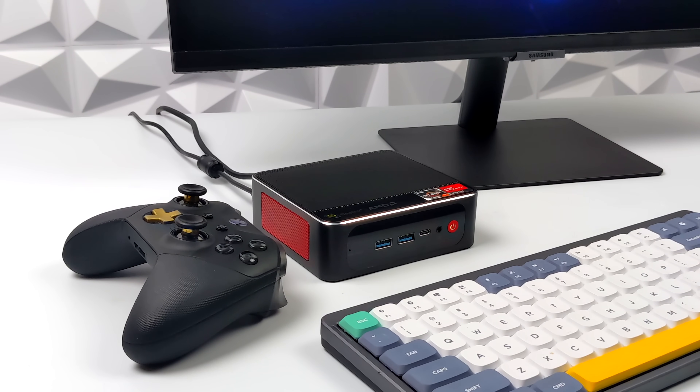Overall, this little mini PC turned out to be the best performing 4800U device I've ever tested, be it a laptop or a mini PC. It really comes down to the fact that we're able to up that TDP to around 45 to 50 watts, which really helps keep the clocks up on all 8 cores, 16 threads, and the Radeon Vega 8 GPU. Even at that higher wattage, the highest I saw the temps go was 93 degrees Celsius. That does seem high, but it thermal throttles at 95 and we didn't hit it. Under everyday normal use, gaming, and emulation, you're not going to see thermal throttling on this setup, even at 45 watts.